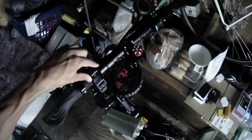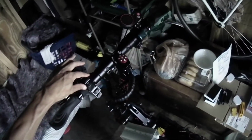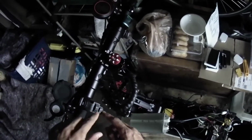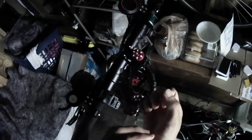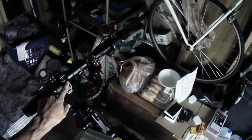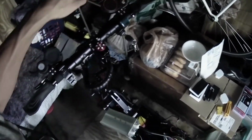light switch unit. This is very important because this unit has everything. It controls your headlight, turn signals, and horn. All these wires are connected, bundled together through a cable housing. So it's got a lot of wires. So you need to make note of this. You need to label them, label this, label that.